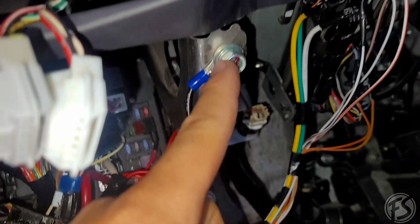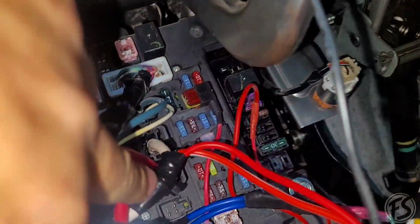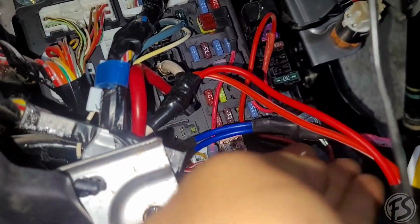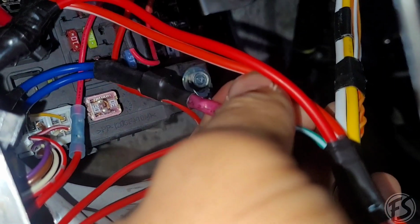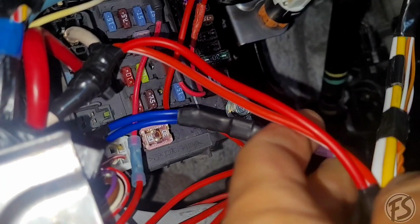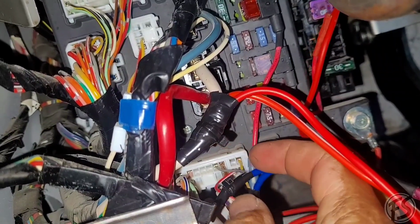As you remember, this is going to be temporary ground until I put back the airbag. The power would be right here. Zip tie on it just in case. These are not my wiring, so I had to kind of move around. The parking light is kind of tricky. This one has 2 power wires, so what I had to do was on the green white of the Compustar, you need 2 3-amp diodes, 12 volt. That way it'll go to both parking light. The plug would be this bottom one right here, this white.